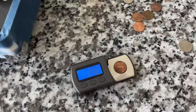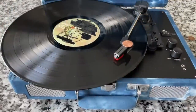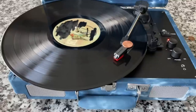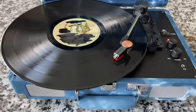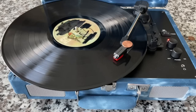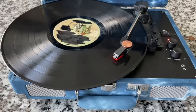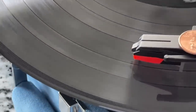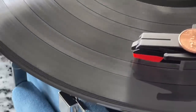We've added the penny to the top. So the cartridge by itself was tracking at six and now with the penny, it is tracking at eight — eight and change, no pun intended. So let's go ahead and start tracking with eight grams of downforce, grinding away the soft vinyl material. At what point will this actually damage our records? How much weight does it really take to destroy your records? Visually, I still don't see any damage, even at eight grams.